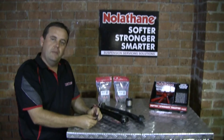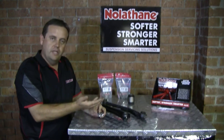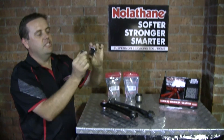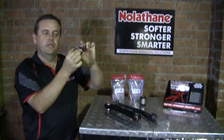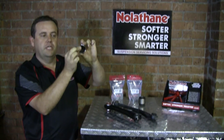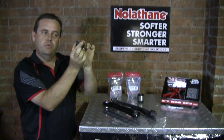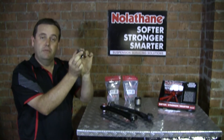What we have to do is actually jack up the vehicle underneath the rear spring seat, underneath the lower control arm. What that means is by jacking it up there, you're actually testing that little nylon or nitrile socket for its movement at that point. If you let the wheel go to droop, even though this nylon socket might be worn in a particular position, you actually roll it into a new place. The suspension will also apply a certain amount of side load.